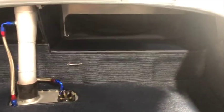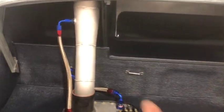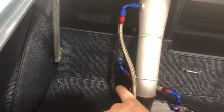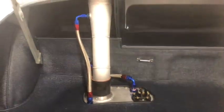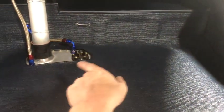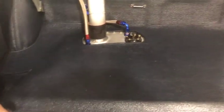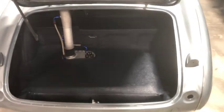Here we are — the finished boot. The only remaining pieces I added are this rear bulkhead section, which I had to carefully cut a little hole around that — not an original hole but similar to what the originals did; you just cut a straight line up and punch out the hole wherever it is. And here's the main boot mat, which I had to follow the original pattern, but instead of having the fuel filler here I left that solid and cut out around all of this apparatus, so that's a non-standard cover but very similar to the standard cover.